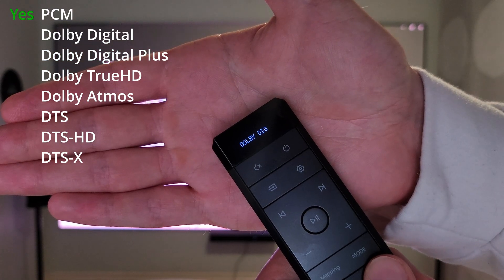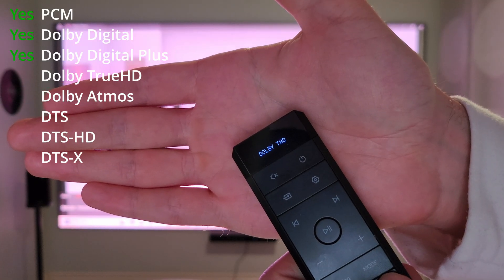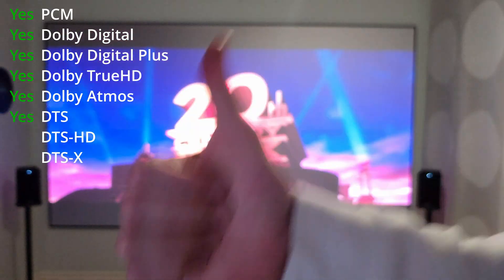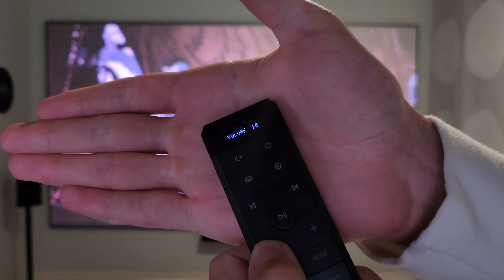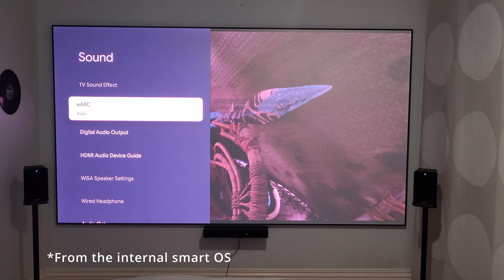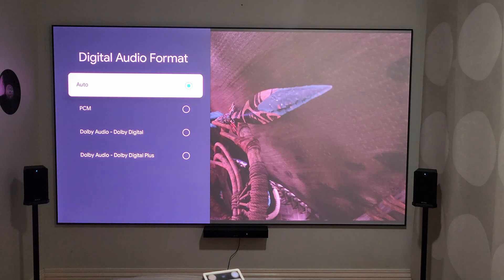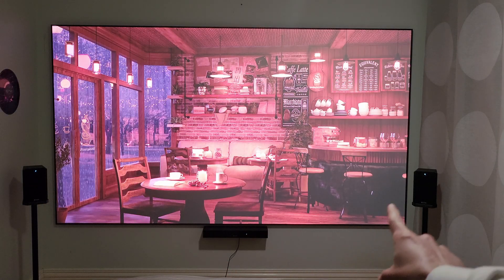I wanted to validate which audio formats the Thunderbeat supports in pass-through mode, so I hooked up my computer and played various audio files. The long story short is that it supports all of the audio formats you would want. There's a handy audio format button on the remote that tells you what format is currently playing for easy troubleshooting. A caveat though: not all TVs and projectors support passing through all audio formats, so if you're not getting sound you'll want to disable pass-through and enable auto audio format, which will most likely come through as Dolby MAT — PCM with Atmos metadata.